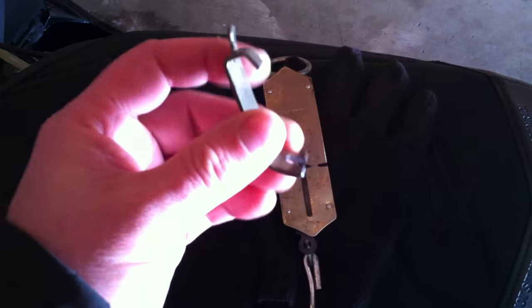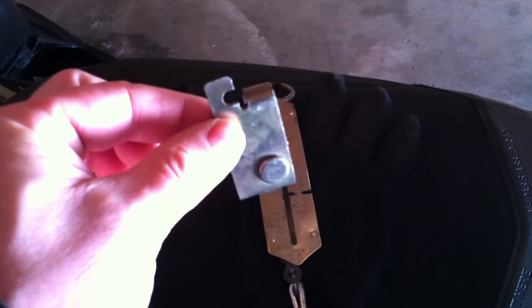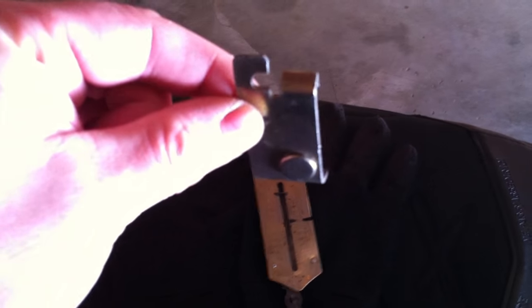This is something that a lot of guys these days don't know about because I think they stopped making these, but Skidoo used to make these. It's a little clip, I guess. I had to tweak it a little bit. I had to bend this a little bit more down here and grind this out a little more so it would hold good. But basically, this sits right on your secondary. I'm going to try to show it here. See, it kind of sits in there. So now it gives you a hook on the top. And that's what you want. I don't know if you can see that any better. If I can put the light on it. There, see how that is? And now you've got a hook on the top of the secondary.